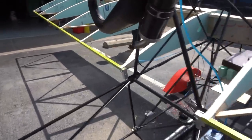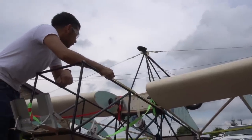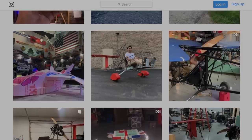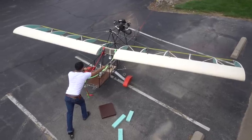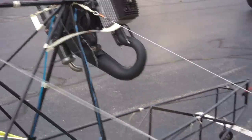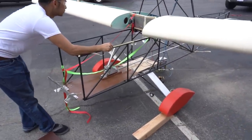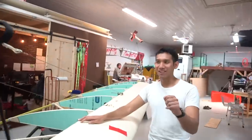We completed the wing stress test and also installed the engine and actually just broke it in - did it with the wing on too, because I wanted to make sure the wing would not come apart from all the vibration, because that thing shakes a lot, surprisingly. Now luckily one of my Instagram followers - hey, if you haven't followed me on Instagram you should, I also post on Twitter. All the normal nuts in here that don't have stop nuts or any sort of loctite or locking mechanism - they all vibrated and fell off right when I was running the engine in.